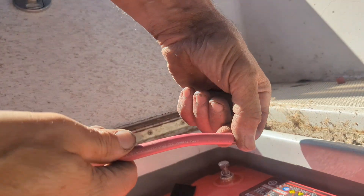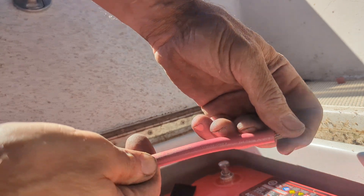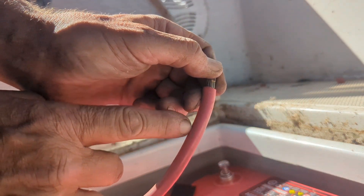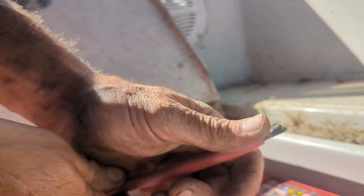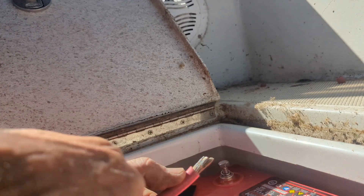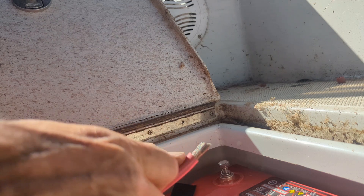The Duffy is using 4 AWG wire, so we're going to find a 4-gauge lug to go with it. I also want to inspect the copper — is it in good shape or does it have a lot of corrosion? I like to flex the cable and make sure I don't hear any crunching sound.